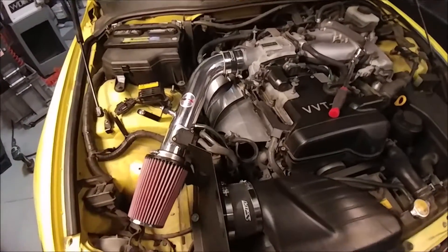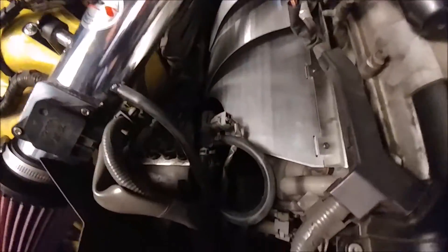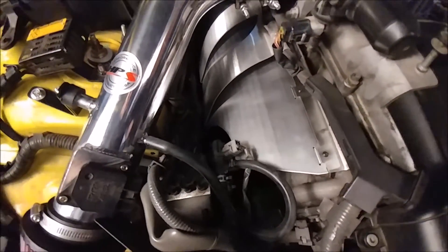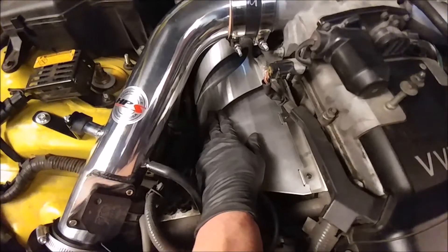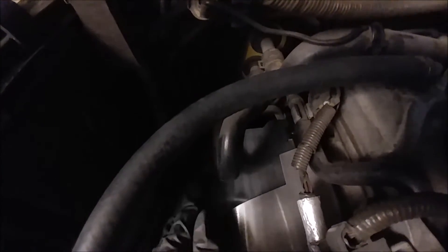Okay, so I've gotten it squeezed through. One thing to note: if you're really picky about stuff, you may want to put some masking tape on this shield. This EVAP relocation was a little bit tricky to maneuver around. The second interference point would be back here — the primary that comes off the head that wraps around there; you'll need to get it over there.